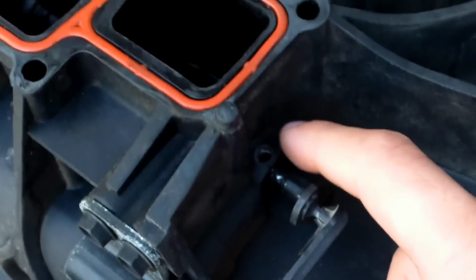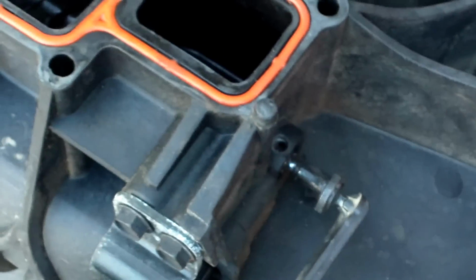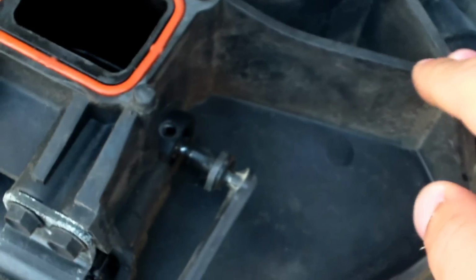That's why it's quite a small air leak. That's why it even makes a whistling noise. Now, this hole that you guys see right there, I don't have much light, but there's a hole right there. That hole we've actually made because the customer doesn't want to spend $2,000 to fix this. It's a check engine light, it's a leak, it's minor, but you still won't pass inspection. At least in Mass you won't.